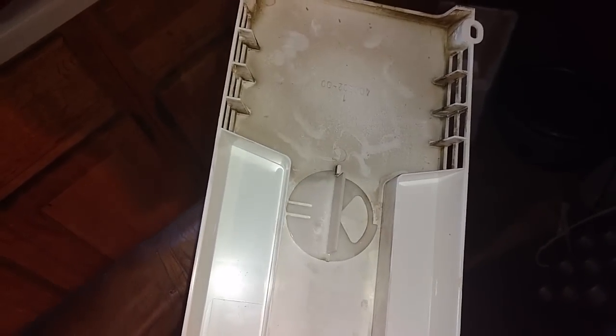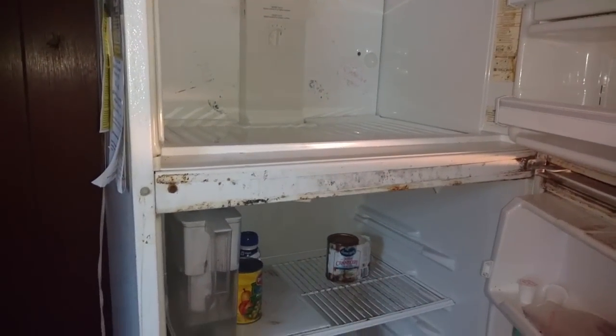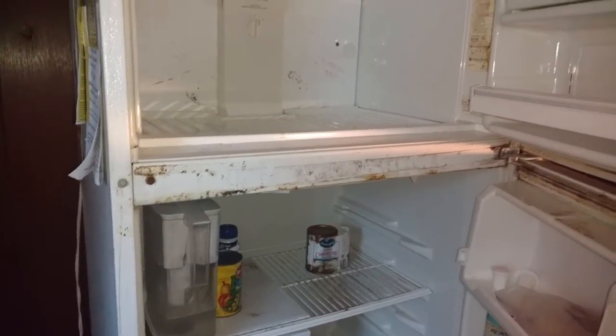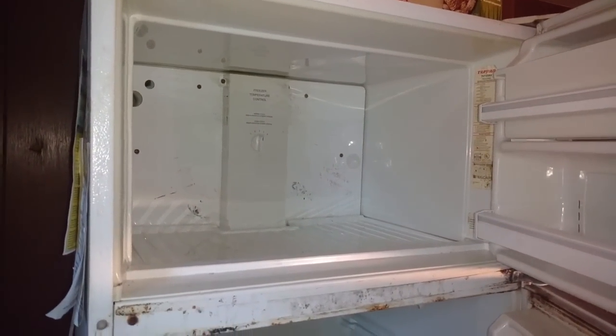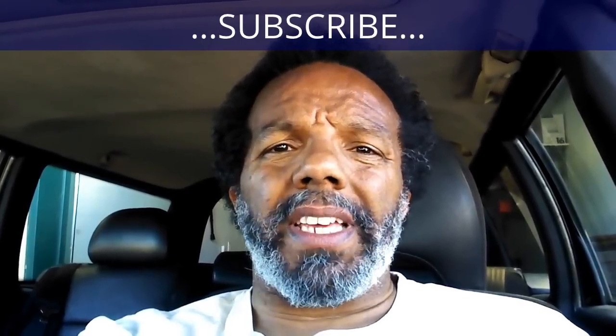Next is the air baffle — it has two screws, slides in place, locks in down there, and keeps your air going the right direction. This piece here limits the amount of air that goes down there whenever you turn that knob. Okay, everything's back together. Just got to let everything defrost so there's absolutely no ice in there, then close it up, plug it in, and it should work. I'll check in a couple days, a week or two, to make sure everything's still working. If there's any other information, I will post it in the comments below. If you feel this information was useful, please like it and share it with your social media friends. You can subscribe to my channel to get notifications of future videos, follow me on Twitter, and if you need to contact me directly, please visit my website. If you have any questions, leave them below and someone or myself will reply. Thank you very much for watching.